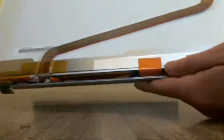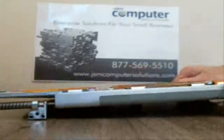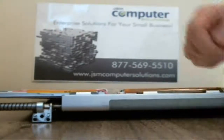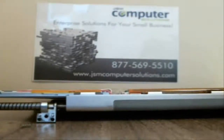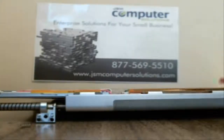So you have these orange, it's basically tape, but it's part of the LCD inverter cables. You're going to pull those off because behind them are screws for different reasons, and you have to take them off anyway. So pull those off, just to make sure you don't miss any screws before you start pulling at stuff. Basically what they're covering up is the screws for the metal part.